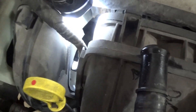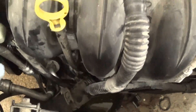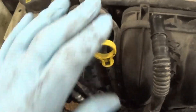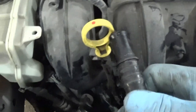I finally found a spot to show you. If you go through this one hole in the intake right here, you can see those two bolt heads — and there's a third one which I don't think you can see, over on the left side of this intake runner. There's a third bolt head down here. I tightened it completely from the top side down under the intake runner right here. There is enough room you can get your hand in there, though the camera doesn't fit. It is just a pain to even see what you're doing on this car. The thermostat housing lives under here. I'm going to have to bring my lower radiator hose back up, get it plugged on, and then this hose as well goes back down in there.